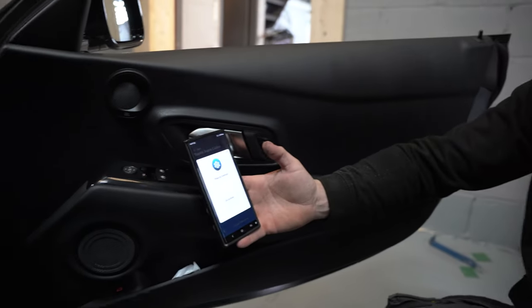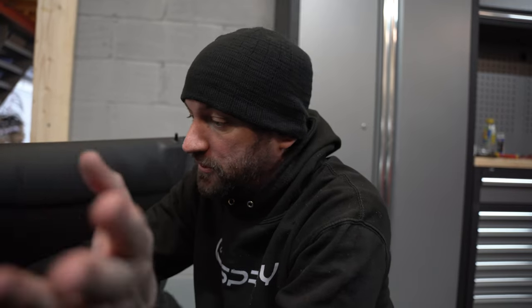Okay. So you had to what? Unlock. Preparing download. So you didn't unlock the ECU, the ECU was already unlocked though. No, it's a totally different thing. So gearbox, you have to unlock the TCU, the transmission control unit, and then you have an ECU, which is the engine control unit. ECU and DME are the same thing. So if we say ECU or DME, we're talking about the engine control unit. If we say TCU, then we're talking about the transmission or gearbox. And the gearbox doesn't have the same thing as the ECU where you have to... No, they're not linked, they don't talk to each other. It's two separate entities in the vehicle. The only thing is that the TCU needs to know the engine speed, and the engine needs to know the load on the gearbox. That's about as much as they talk to each other. They just tell each other temperatures and speeds, and that's about it. But one can operate independently from the other.